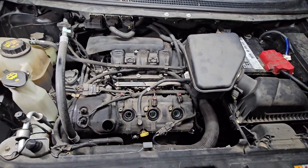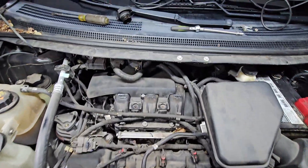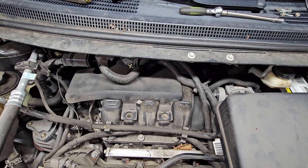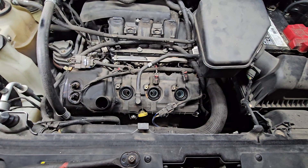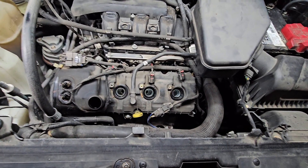Got a misfire. So what I'm going to do is take the three coils that were here in the front and switch them to the back, and take the three in the back and put them on the front — just in case that number four coil may be bad, so I don't have to take the intake back off. There's nothing wrong with the first three coils in the front.